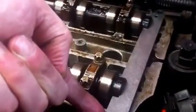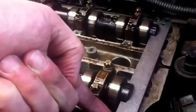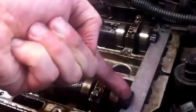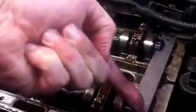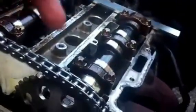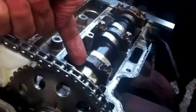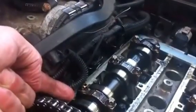The flat metal bar comes in between the twin cams at the opposite end of the timing chain. It slides into a groove here. You know you've got this the right way up because it won't go in if the groove is too low — that means they're the wrong way up. To get these the right way up, that cam should face out towards the front of the car, and that cam should face inwards.